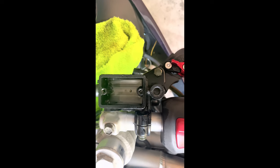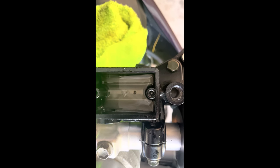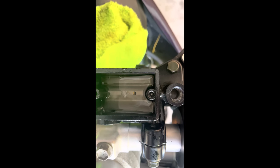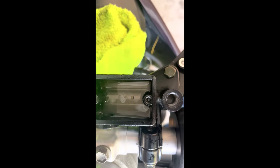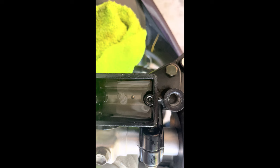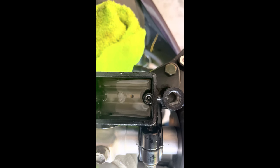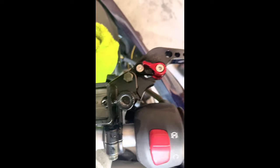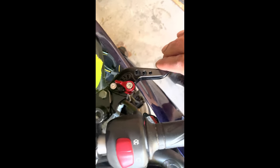At this point I was getting super frustrated because I can't seem to get any pressure on the calipers. I was trying everything — I've been bleeding the brakes forever. But I noticed that when you go with slow, steady pressure on the lever you can see the bubbles come out, so I was doing that for a bit and that seems to work.